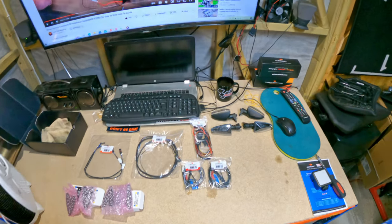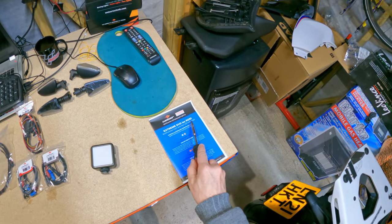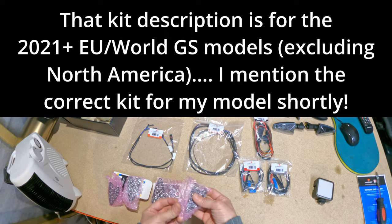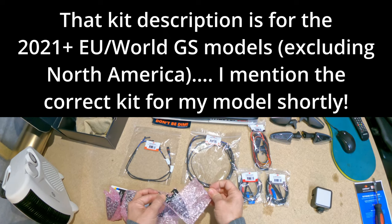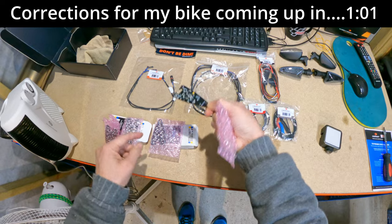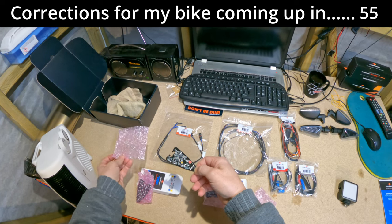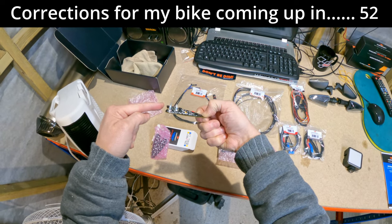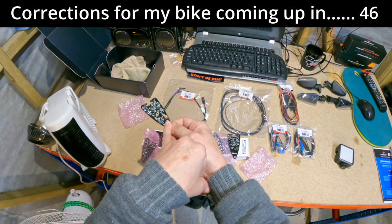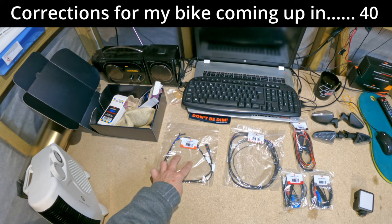So let's have a look at the gear we've got with the Visor Technic Extreme Evo ISS RGS1 kit. Probably the most important things are the front and rear indicators - a pair of fronts and a pair of rears. This is one of the fronts - I can tell because it has three terminals. This is one of the rear pair - it has four terminals on the PCB and also has a switch which affects its operation.